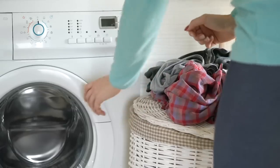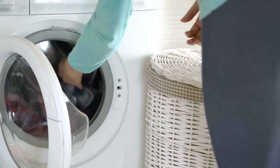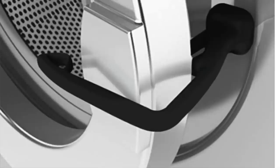Your preventative maintenance of running a load with bleach once in a while is going to be great. Some washing machines have a front door that stops halfway like a safety stop. Some LG models have a little spring-loaded magnet underneath the glass that holds it ajar. There's also doordock.com — a C-shaped device that magnetically holds against the washer door and touches the frame to hold the door open just a little bit. Make sure those drain holes are clear — sand and hair don't go away like slime, so if you have a mechanical blockage it needs to be addressed mechanically, not just chemically.